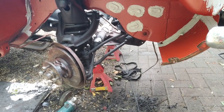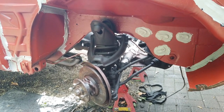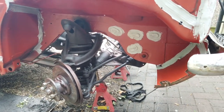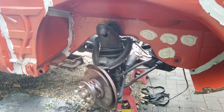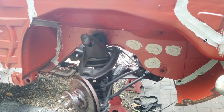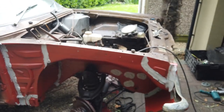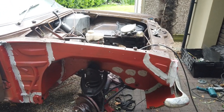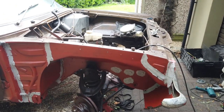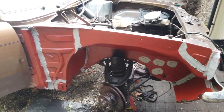There's a grey primer underneath the bitumen that I took off, and I was careful not to damage that grey primer because that's Ford's original grey body coating. Wherever it was scuffed and gone through to bare metal the red oxide takes over and covers it - so we shouldn't get anything coming back there. We're going to use a stone chip stoneguard, possibly a colour-matched one, on this later. But we'll do the other side first - we want to do both sides with that Raptor because once you put the activator in it sets within about 12 hours, so do both sides in one hit. We'll probably colour match it to tawny brown.